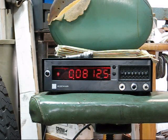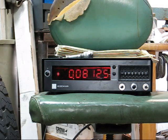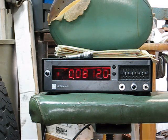What we're doing here now is we're going to bring the camshaft up to 50 thousandths before it comes over the nose. Right now we're at 80 thousandths, and we're going to start bringing it up more until we get to 50 thousandths — you can see it coming up right now. We are just about there. Now we'll go back to our degree wheel and read our number. And here we have 73 degrees.